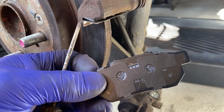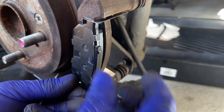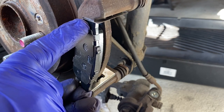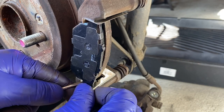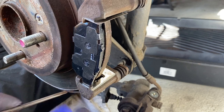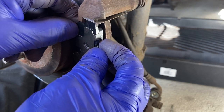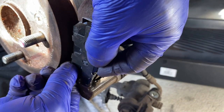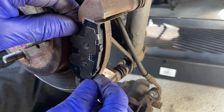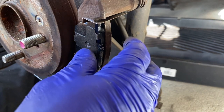Now we'll get the pads. Here's our pads — that's the inner pad there with that tang on it, and the outer pad there. I'll show you the outer pad going in before I grease it up. You just catch it there and compress that spring. Then use a little screwdriver and just prise it in — you're pushing that spring down in order to get it in. Make sure that it moves freely; it's got the ability to move. So all these stainless guides just allow that pad to move in and out and grip the disc.